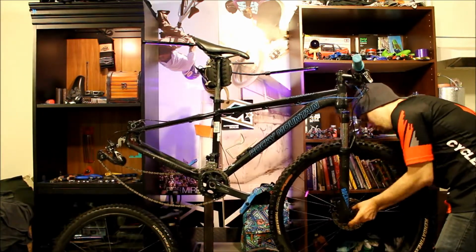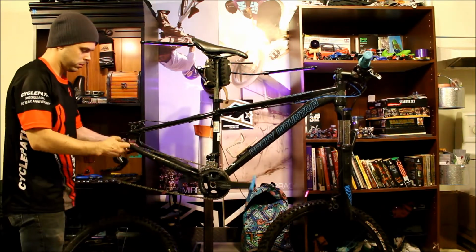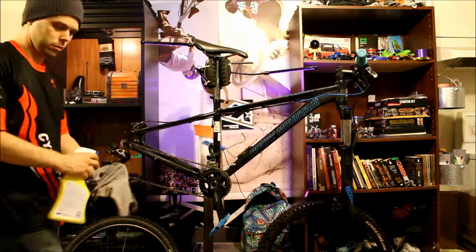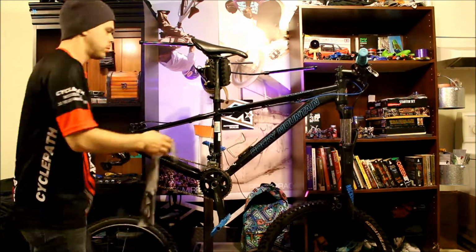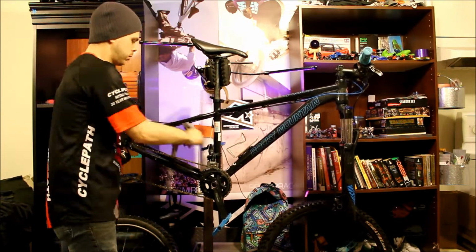Finding a way to hang the bike by the seat makes cleaning much easier than having the bike on the ground, so I recommend finding a way to do this even if you don't have a work stand. Putting a broom handle between two chairs and hooking the saddle over it works, for example. Hanging the bike makes it very easy to remove the wheels for access to tight spaces in the frame without tangling up the chain or scuffing your levers and saddle.